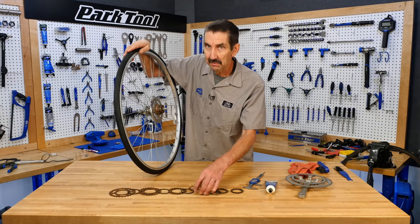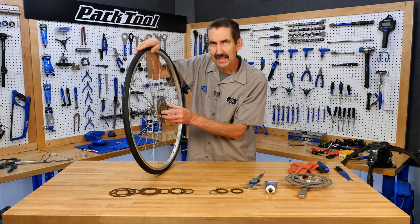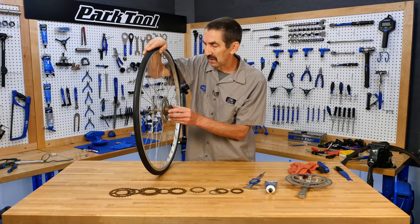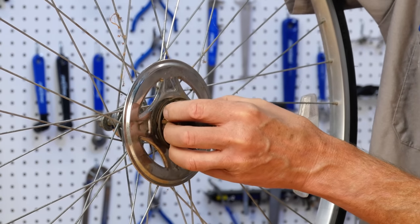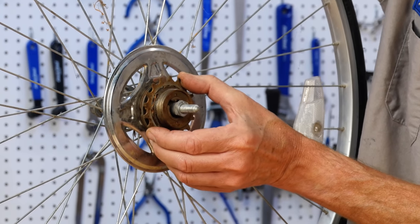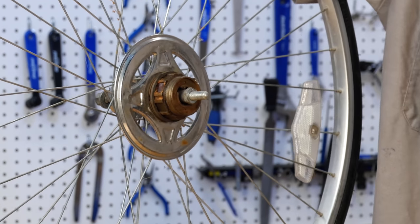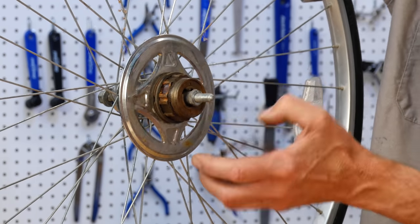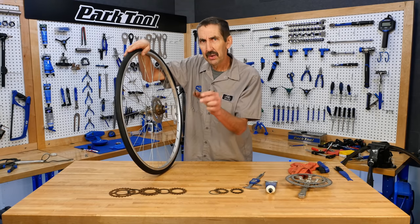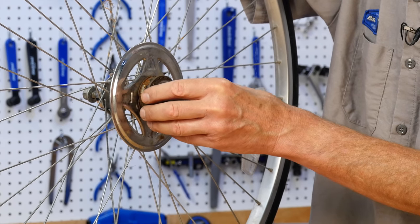Ideally, I would like them to have this one, the 17. But you'll notice that's a sliding sprocket. It has to have spacers. We have to have many spacers this size go on to take up that room, and this lands just at that edge so that the tooth sprocket can push against it and lock it down. That's tough. This one here, we measure the inside diameter, 52 millimeters. I don't have enough spacers like this. Thin, but a 52 millimeter ID.